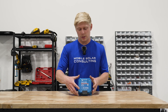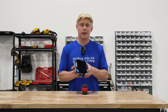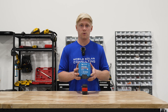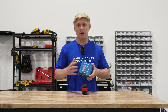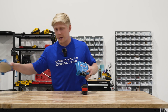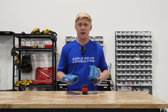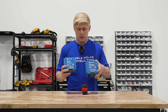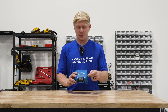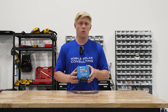Another thing we really like about this for our installs is that it's got a heat sink on the back, which is going to help the unit dissipate heat more quickly and hopefully avoid the need for a fan. We've only installed two of these so far — we just got our first shipment in about two weeks ago — so far we have not had any overheating issues and we have not been using fans. The standard Orion XS does not have a heat sink, and basically all of those were overheating unless we put a fan right behind it. Same exact profile, just slightly thicker with a heat sink. It also has a VE.Direct port — same as the Orion XS — and can report information on alternator charging directly to your Cerbo or other GX devices.